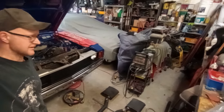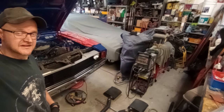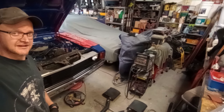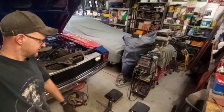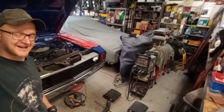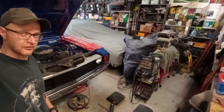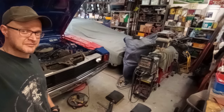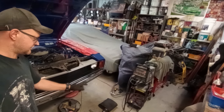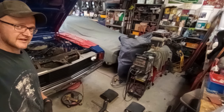Okay, what I think I'm going to do now is clean up the inlets on those 2 Redback mufflers, then splooge a fair amount of weld onto those mufflers and connect them firmly to the merge pipe section, and hopefully that will be enough to hold them together while I move them around under the car. This is all starting to get quite heavy now, so hopefully my tacks hold, because we're getting to the penultimate part of this, which is when I hang the exhaust system. So I'll weld that, but first I'll grind them up to tidy everything up as best I can before I weld it all up.